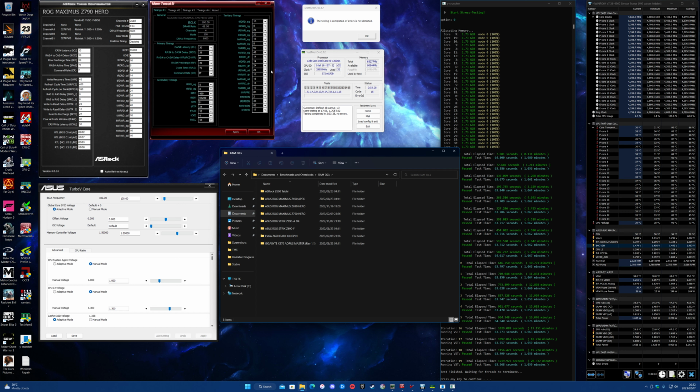I made DD auto as well, just out of curiosity. And funny enough, if you look at it now, when you have 64 gigs of RAM, the dual rank and dual DIMM timings actually train properly, whereas with single rank they get all wonky. So you can see 14-14, 24-24, 16-16, and 16-16. It actually matches. It's kind of weird how they train correctly when you have 64 gigs of RAM.